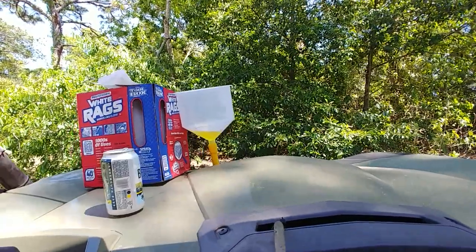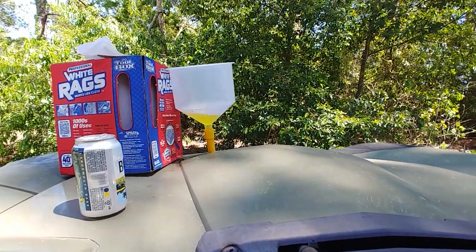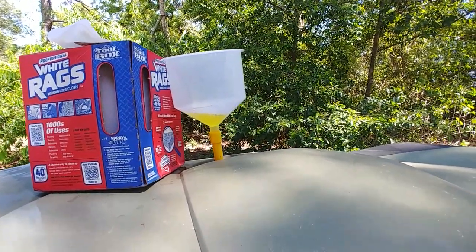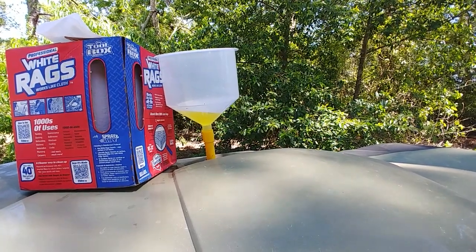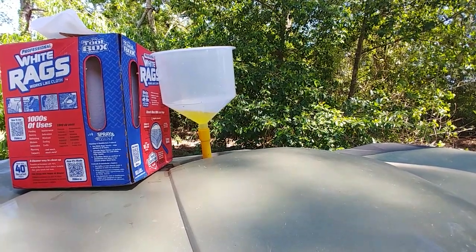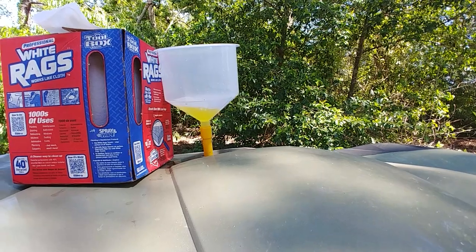Now I've got it to a point where it'll actually run without going right into overheating, and it is taking more fluid. You can still see it burping there. It'll burp, then it'll take more fluid down into the extra radiator. So I've just been sitting here letting it run as it takes more fluid. The fan turned off, so hopefully something's going right. As you can see it burping, it'll take more fluid and I just add more fluid.